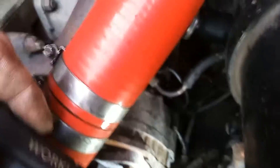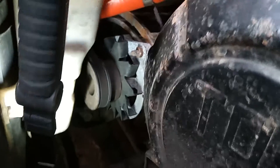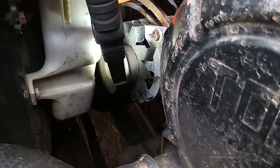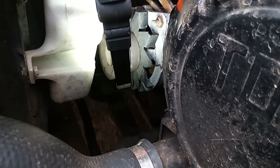One thing a lot of people have trouble with is the alternator conversion. The alternator I went for was one from a 1.8 Vauxhall Astra. That is a standard four-track pulley on the end of the alternator — the one off my old alternator — because it's got the correct spacing at the back and the correct V for the belt. What you've got to do is shim it out, because the shaft that comes up the alternator is a little bit narrow in diameter compared to the hole in the pulley. I used a piece of copper pipe, put it in there, tapped it in, and it fitted absolutely perfectly — took up all the slack I needed.